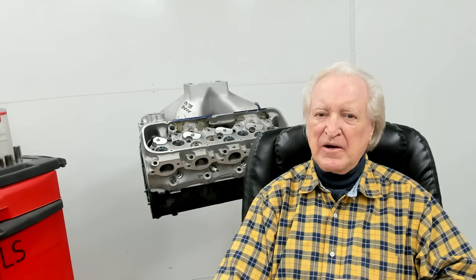The use of a 30 degree seat virtually demands this groove. It's not a bad idea to apply it to a regular 45 degree seat — it will help power. I've done it on a 50 degree seat and it looked slightly better, so it has almost universal application. But for a really effective seal, we need to go slightly further.